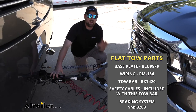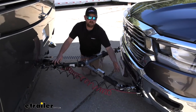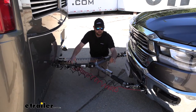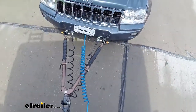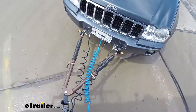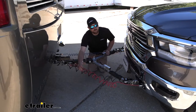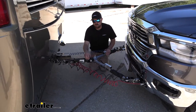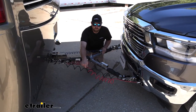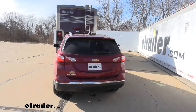There's going to be a total of five main components that you're going to need. The first one will be your base plate, and that's going to provide us with a solid attachment point so we can hook our tow bar up to it. The tow bar is the second component — it's the physical link that connects the front of your vehicle to the back of your motorhome. The third main component will be your safety cables, which are there in the event of an unlikely disconnect to keep everything paired together. The fourth main part will be your tow bar wiring, which transfers the lighting functions from the back of your coach to the back of your pickup, keeping you safe and legal.